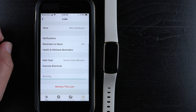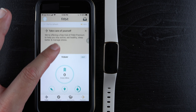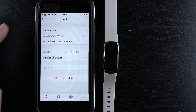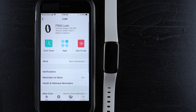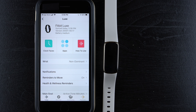The other key thing to know is syncing. From your dashboard, pull down and release to sync your Luxe — you need your phone's Bluetooth on to communicate with it. It'll say 'Syncing your Luxe' and then 'Sync is complete.' If that doesn't work, you can also tap your profile picture, tap Luxe, and scroll down to 'Sync Now' for a manual sync with a progress bar. You can also see when it last synced and note your firmware version number for future updates.